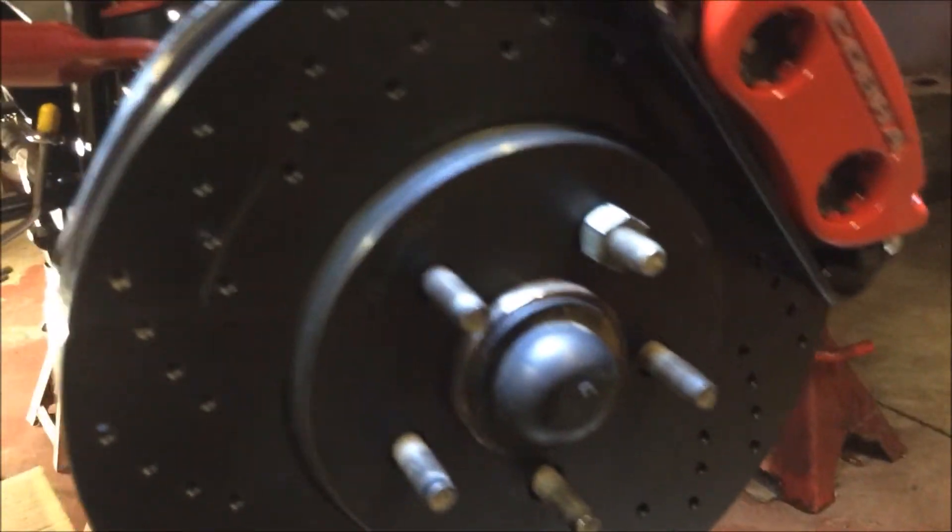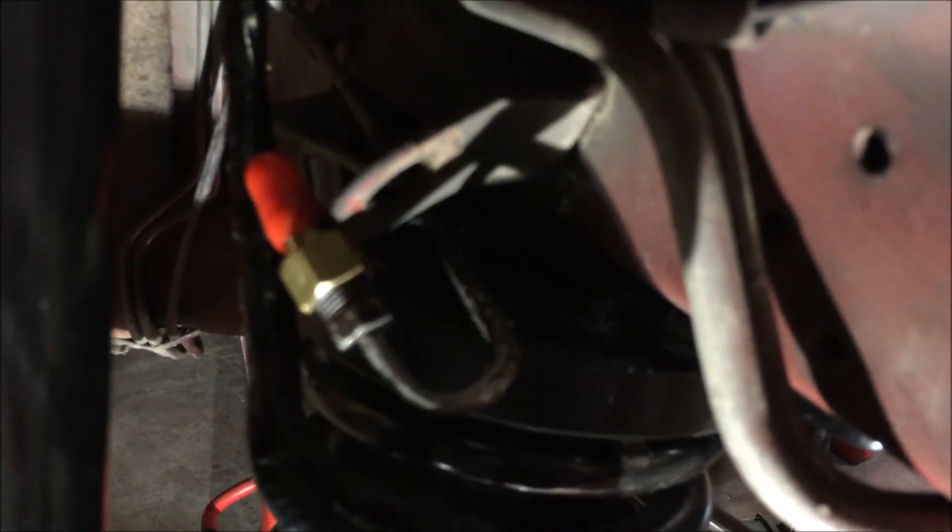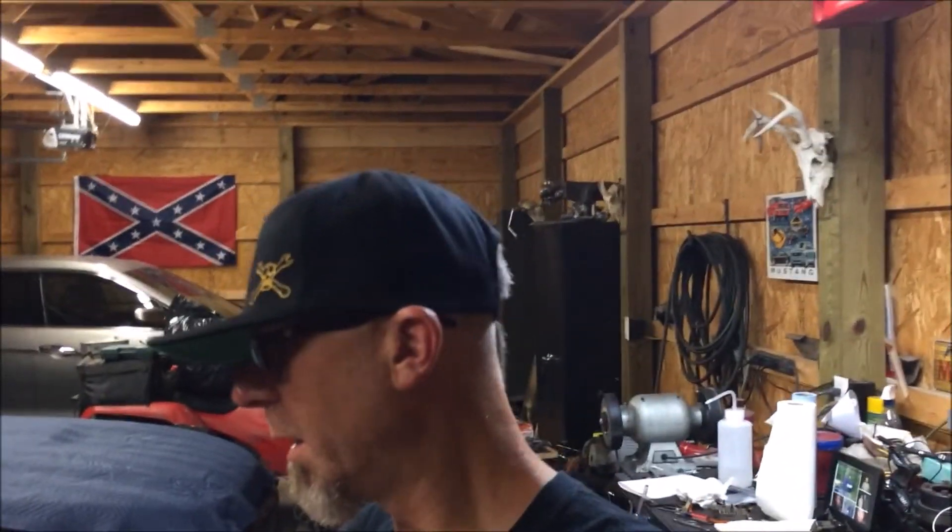As you can see, we've got our Cobra calipers on, we've got our rotors, and we've got the hydraulic line bolted up to the hard line — all that's put together. Now I want to take you over to the other side to show you the adapter I mentioned at the beginning of the video — that's the adapter you need when running the hard line to the hydraulic line. I got that in the kit; go back and check out my videos for the part numbers. That's all for tonight — if you're new to the channel, subscribe, give me a thumbs up, and click that notification bell so you'll be notified when I upload my next video.